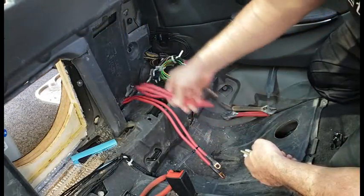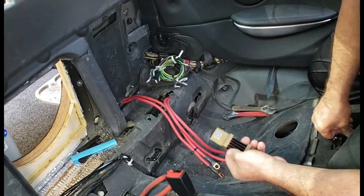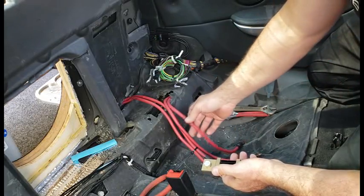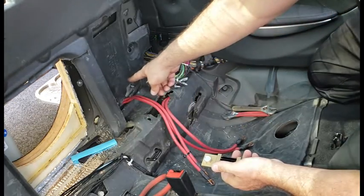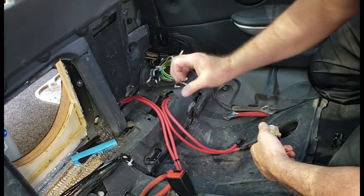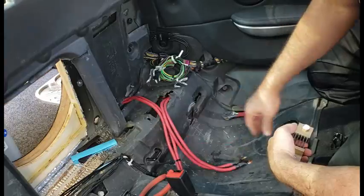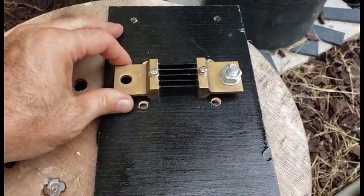As you can see, I've got all the wires ran to this location where I'm going to put the shunt for the amp meter — I want to know how much current my system is drawing from the alternator. These go to the bolt for the original wire. I ran two four-gauge wires because it's easier to tuck two wires instead of a fat one. Holes drilled — let me zip tie it real good.